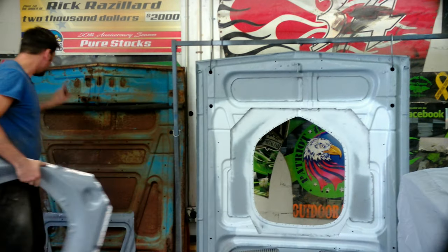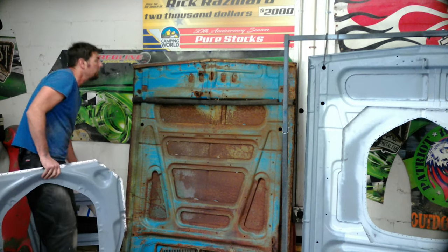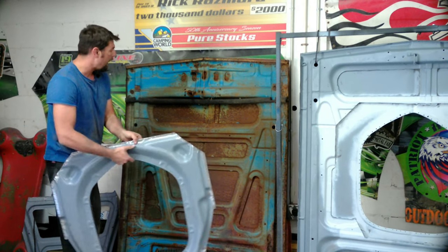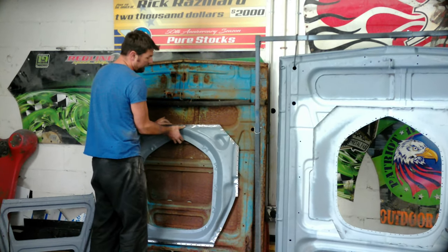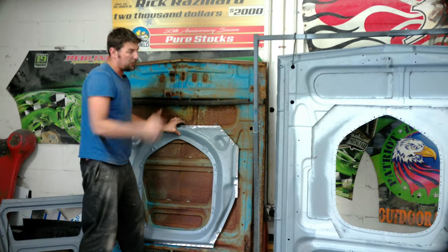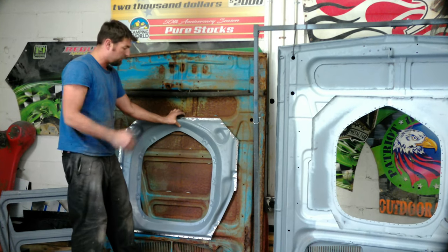Also for you Dodge people — Dodge Challenger flat hood, 70 to 74. Here's the support we cut out of this hood; the hoods are exactly the same. You can see the only main difference on the Dodge hoods in the frame — it looks like this area forward where you don't have the front cowl area on the Cuda. But from here back, the trim ring is not going to fit because the outer stamping is going to be different. However, the main support — the actual hood support — is going to be the same on the Cuda and Challenger. So this part would be the same; you're just going to use a different trim ring, but the process itself would be very similar. What I'm seeing is it will fit on a Challenger, the underneath portion, with the Challenger trim ring.